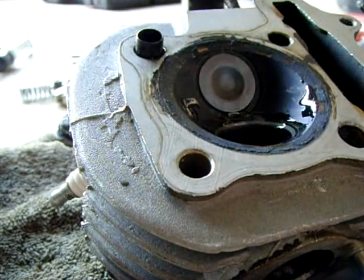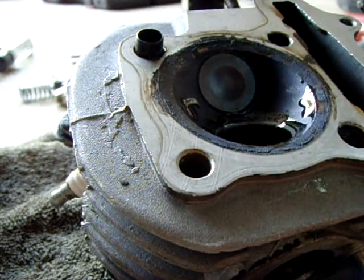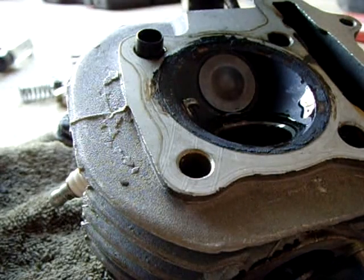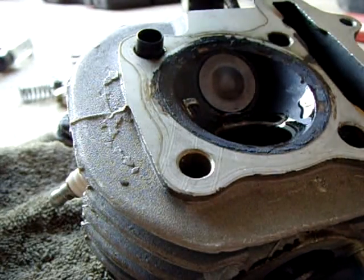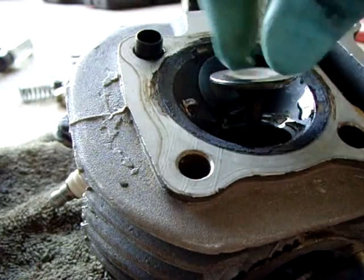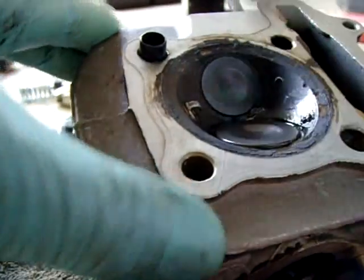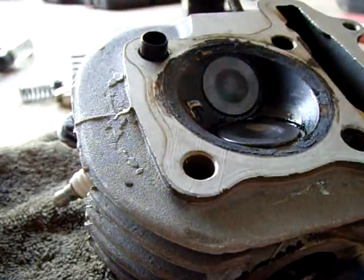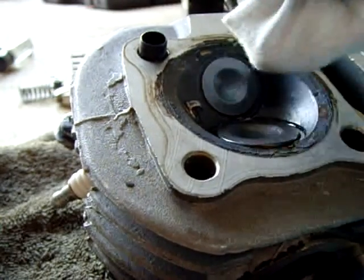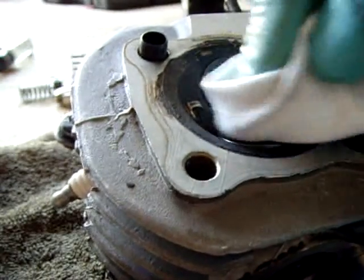Here's the valve that I did the edge on. Make sure you remove all the residue from the valve grinding compound, otherwise you're going to have problems. Nice fit. Some people just buy new valves and drop them in — that's not exactly the greatest because the shape of the valve does not match exactly to the bevel on the head. Always want to grind them.